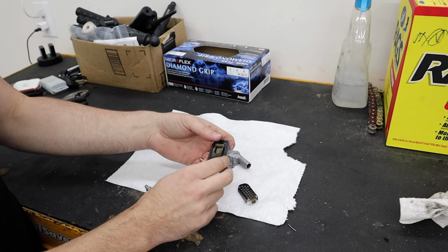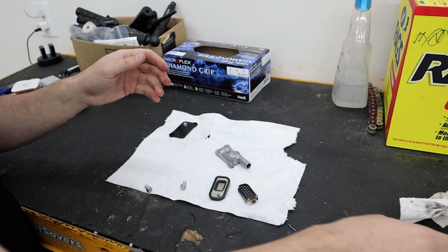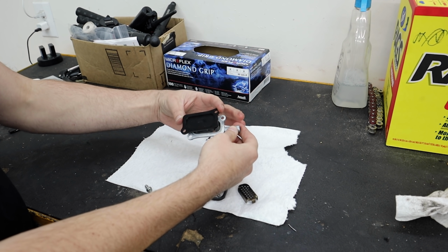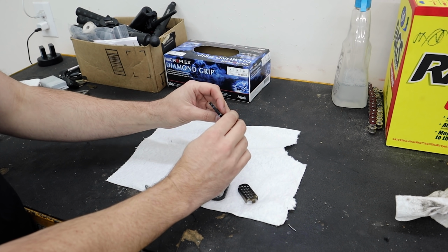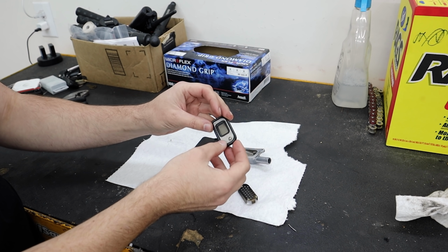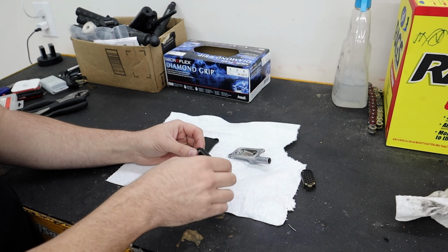And this is like a little reed valve in here. This is what's supposed to be the one-way valve, but they're not perfect. Things usually get past them. And this was the cap. Now what you're normally supposed to do is pop this cap off, get our plate here, which is the exact right size, it's the right thickness, and just literally re-bolt it in. Because we need this in here. See how this has got this like gasket in here? We need this to seal it. Now you can pull this out, you don't need this in there, that's not doing anything anymore.